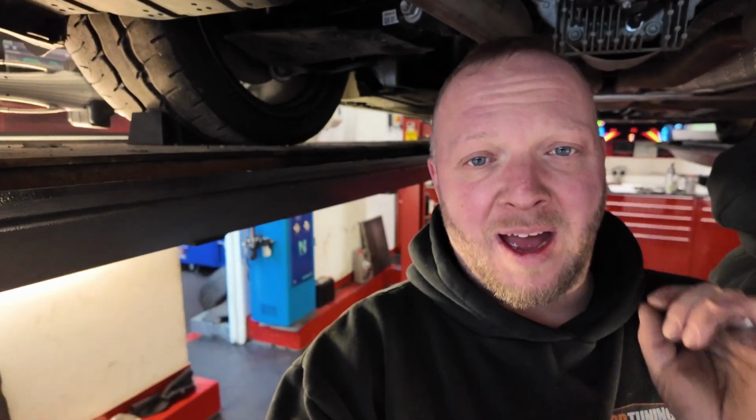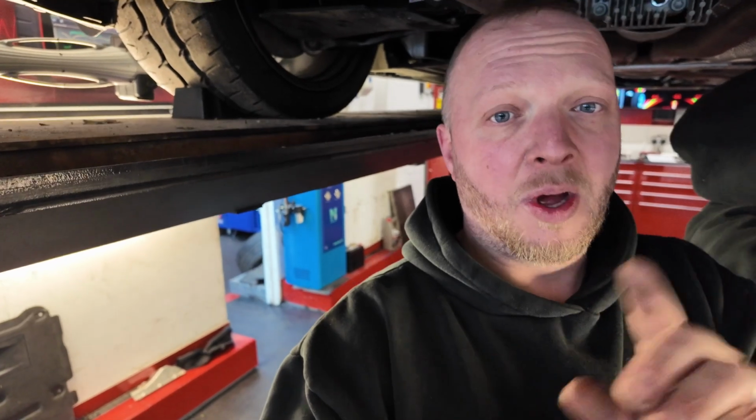And behind me are all the camber caster bolts on all of the underside of the car that you have to chase around, because every time you adjust one, it throws out the front, and then you adjust that and it throws out the back, and you need to track the whole car. So it's a matter of adjust, bounce the car, adjust, until all the numbers are in the green or wherever you want to get them set up.